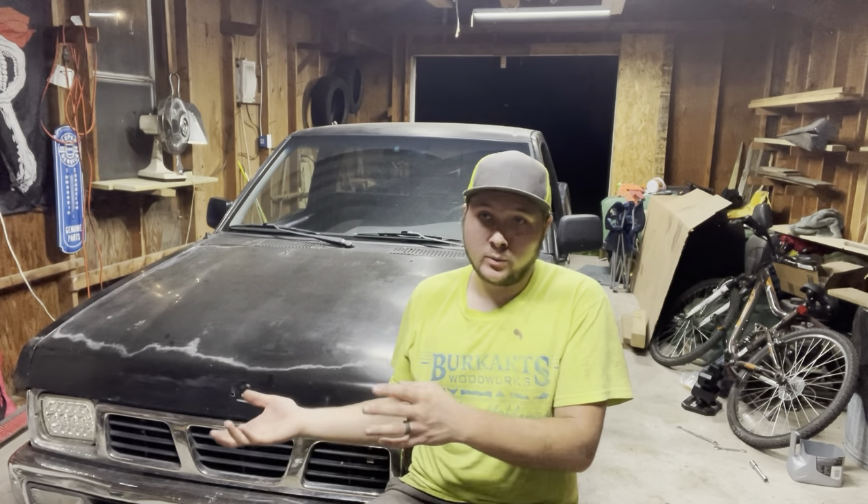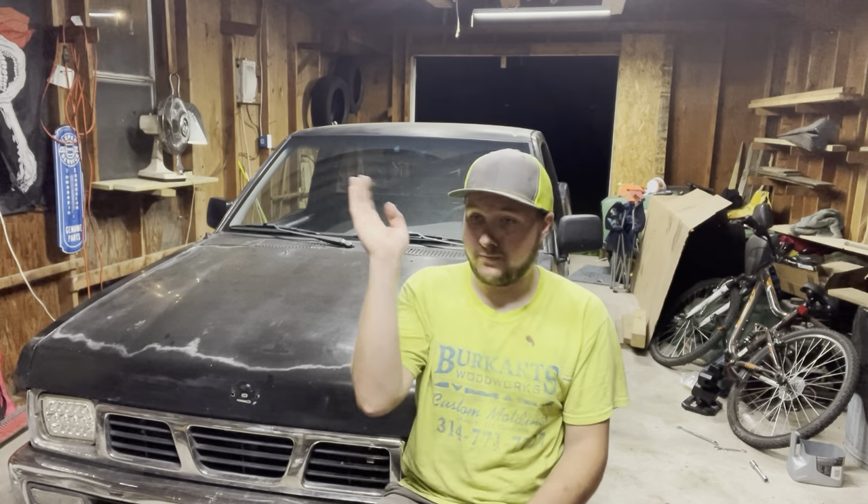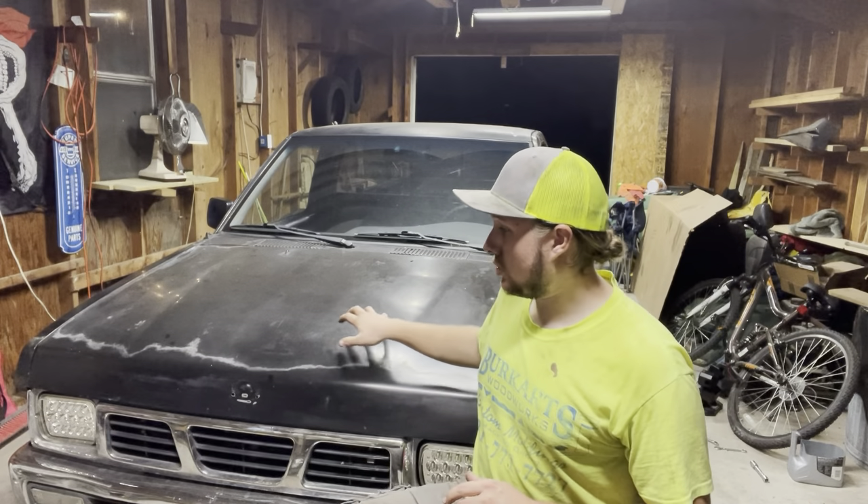That's a wrap on the clutch job for the hard body today. I wanted to do a recap of everything we did — if you're clicking on this video because you need to know how the transmission and clutch job goes on a hard body, skip to here and I'll give my summary. I purchased for my '96 truck a clutch kit listed as for '95 or previous that included the pressure plate, the actual clutch, and the throwout bearing — I used all three pieces and it worked just fine.